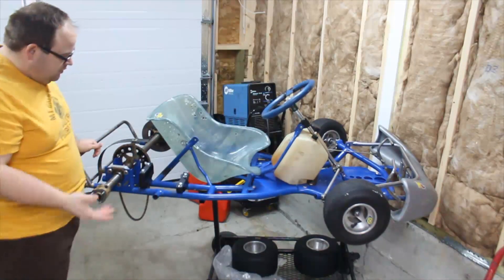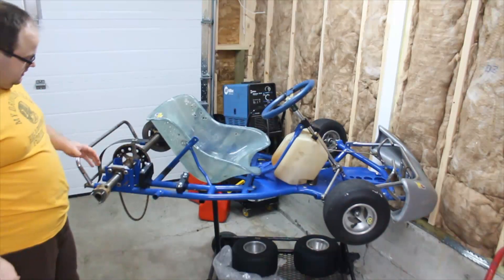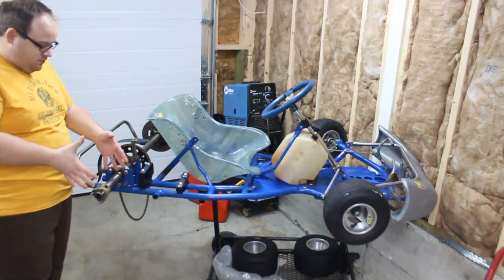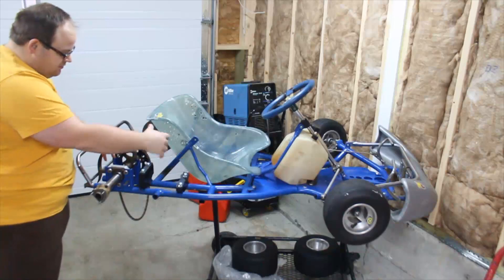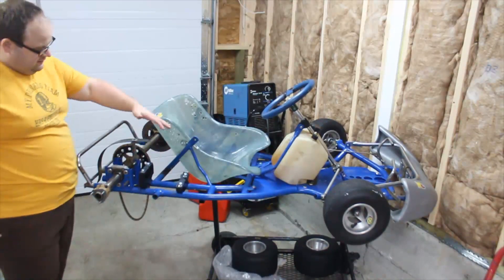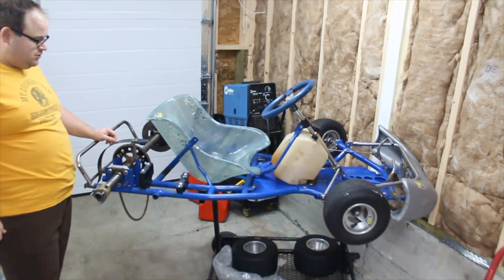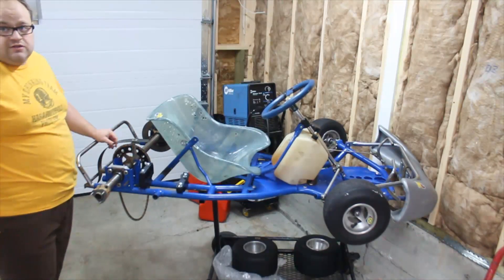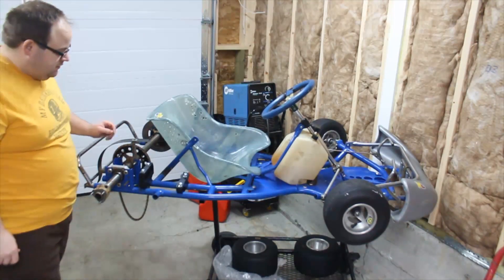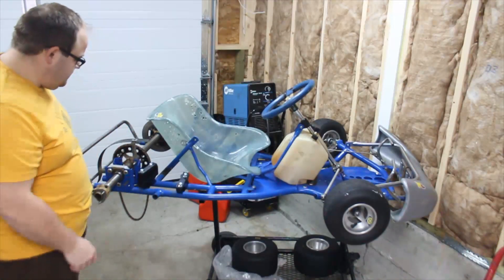You can also get five-degree mounts. The sole purpose of the angle, I believe, is to make sure the engine's air intake and related components clear the tires, which sit right about here. By tilting the engine up, it elevates it and perhaps gives some advantage through acceleration and deceleration in terms of where the oil sits in the crankcase.